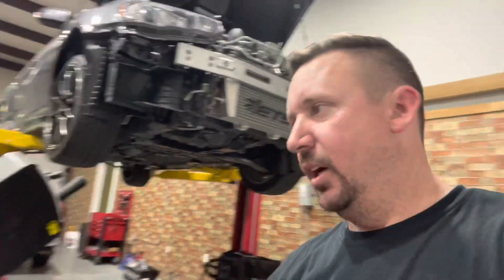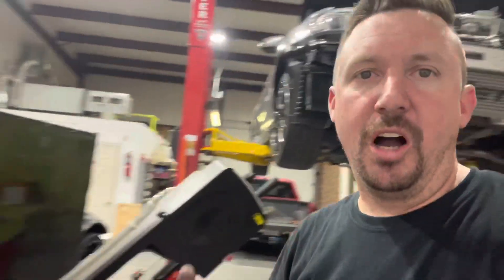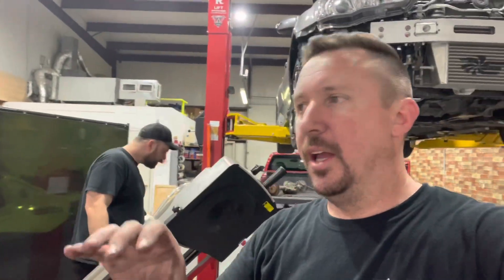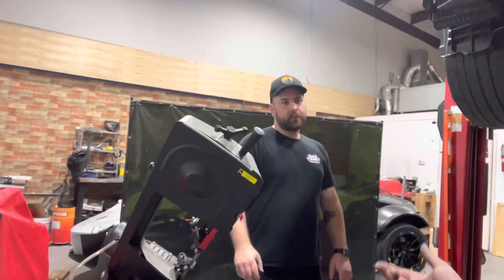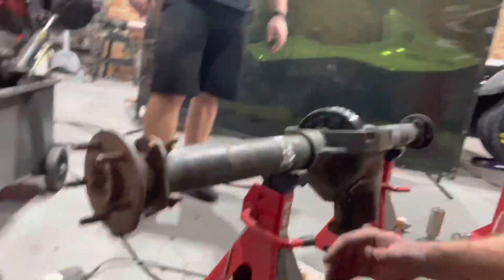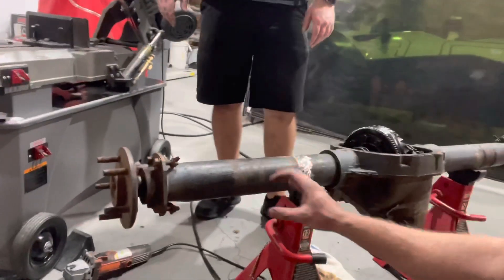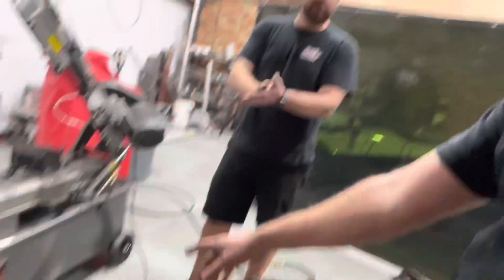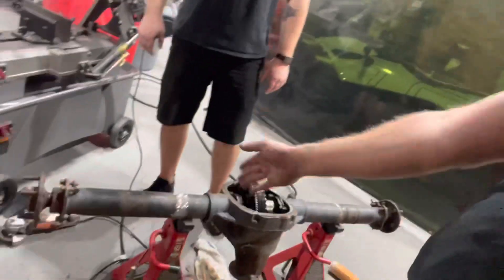Using the bandsaw was a treat because we don't have the alignment rod — the long rod that's meant to go in the axle, centering up under the caps for the differential carrier and all the way out to keep everything in line. So making a close to perfectly perpendicular cut was key to having a straight axle. We ran through the bandsaw, didn't really like the first cut, ran it again with the machine set up a little differently and got a much better cut. When we were done, we butted the two ends of tube together and used a straight edge to confirm everything was true — it's within a very tight margin. Once tacked up and in place, measurements confirmed it was perfectly even on both sides.